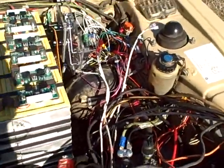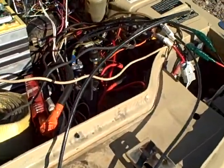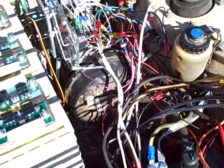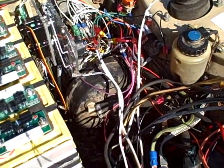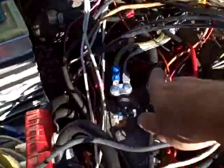It's still a prototype and kind of a mess. I also have a vacuum brake assist system, so there's a vacuum pump up front right behind the grill. I also have the two controllers for the brushless DC motors in the front wheels mounted back here.